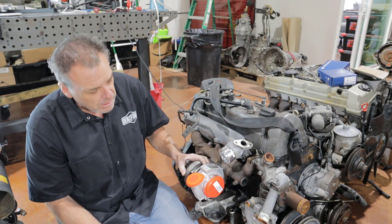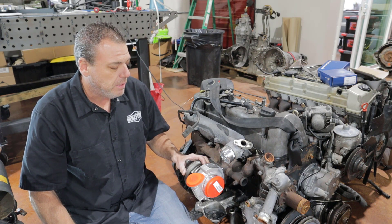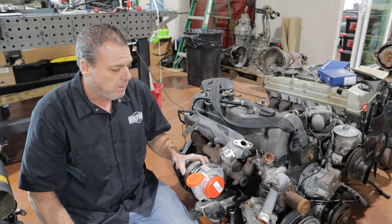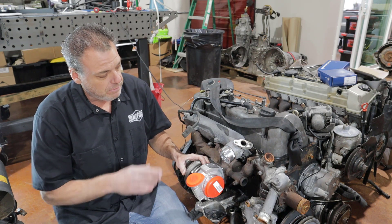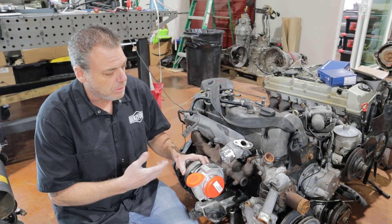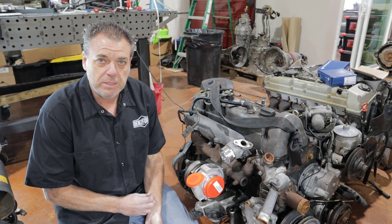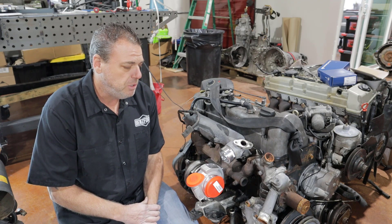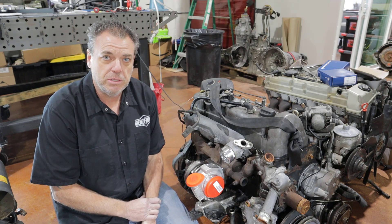The secondary concern is that once a customer has this turbo set up, if they're running one of our pumps that have been modified, they're going to be running a little hot, so we strongly recommend an intercooler. But for a lot of our customers, getting that intercooler set up on the stock intake manifold has been problematic — a lot of people don't TIG weld, don't have the resources, or maybe geographic location is an issue. I have one customer building a G-Wagon in a foreign country who is actually prohibited from modifying certain parts of the engine to comply with environmental concerns.